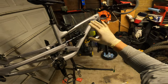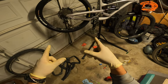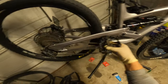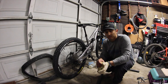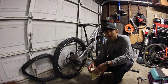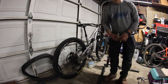Forks are done. Everything's pretty loosely put — I gotta snug everything after I bring the bike down. Last thing I really gotta do is bleed the brakes, put on the chain, make sure everything's good. Fresh pads, fresh fluid. I ended up just putting in the new brake pads and pushing back the pistons — the brakes feel really good, so I don't think I'm going to bleed them. I'm a little too tired for that, but Gabe will be cool with it. They feel good and that's the most important part.